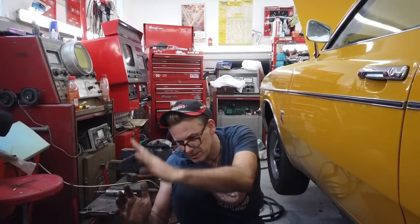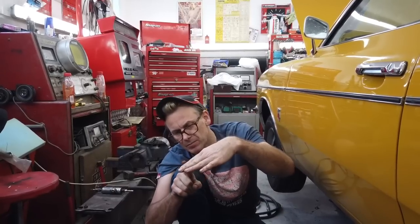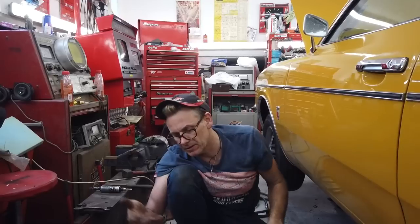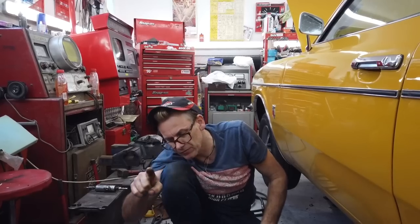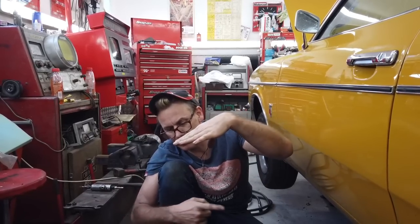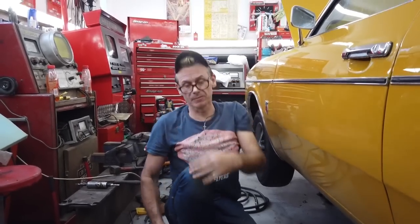Helps when you have a crash, sends the engine under the car, various other reasons, but your engine points down and the crankshaft transmits the power all the way through on the centre line till it comes out of the back of the gearbox. That could be a manual gearbox or an auto, but all of the drive shaft is in a perfect straight line through. So you end up exiting pointing down, and in our case here on the board it is pointing down by 4.7 degrees. Your Cortina may point down by 3 degrees.